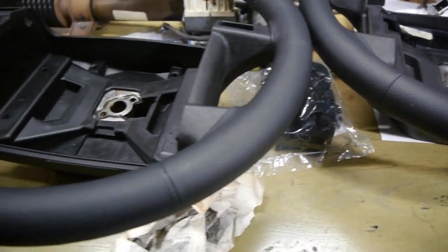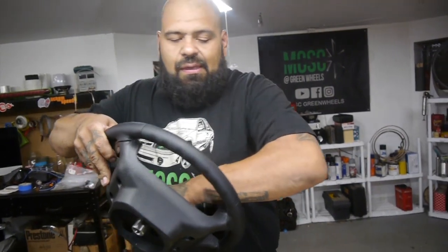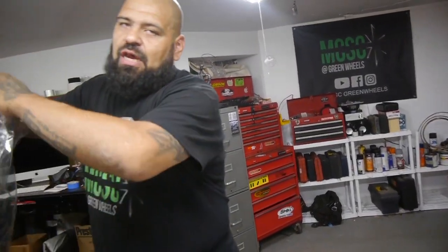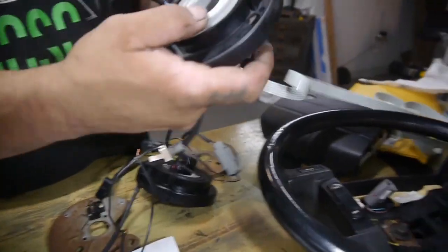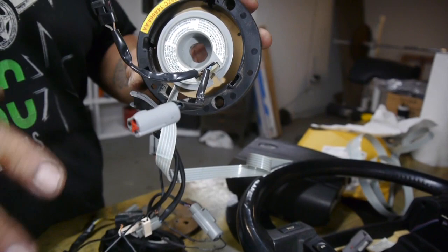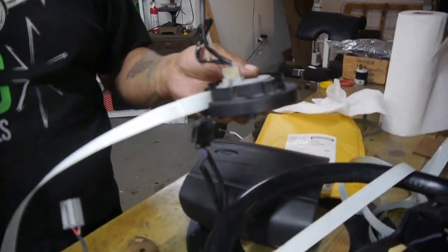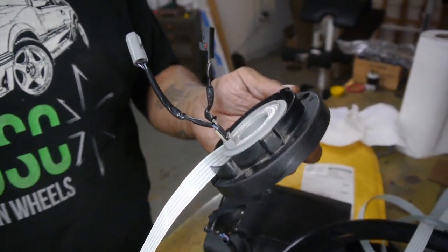Choosing the Cobra steering wheel led us into figuring out we still need to get a horn set up. There are people out there telling us these things are the same — they're not. We were looking around and it's ridiculous what an SRS module, or what they call the clock spring, costs. The clock spring actually carries the power to the horn and your cruise control setup. I already took this one apart — this is the original clock spring that came with Staff Sergeant Reckless. This connector goes to your cruise control, coast, and reset, and the little black one branches off to the horns. This other one goes to your airbag. I kept getting a 5 amp fuse blown. When we started to install the horn, we realized we had no power whatsoever — I wasn't getting continuity.